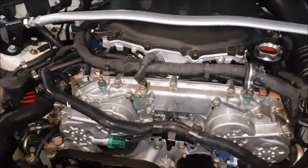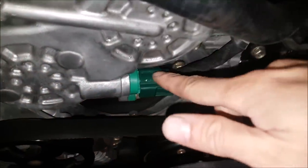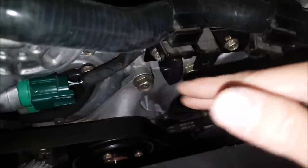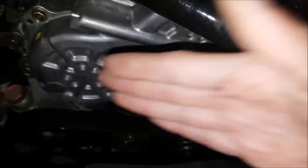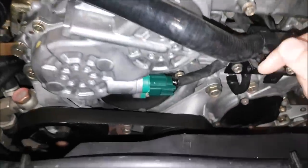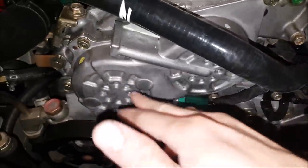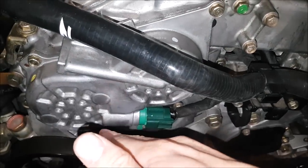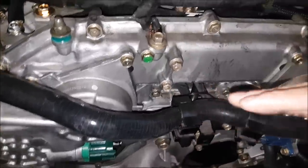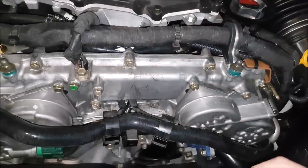Most of these tips today are going to be most beneficial for the rev-up engine. We have these plugs over here for exhaust timing. I at first thought these were for cam position sensors, but the cam position sensors are actually on the back of these engines. Those of you with regular DEs only have one of these on the cover — the rev-up engines have a secondary one for the exhaust timing. Most of you with regular DE motors can just move the wiring back, and we're going to show you how to do that.